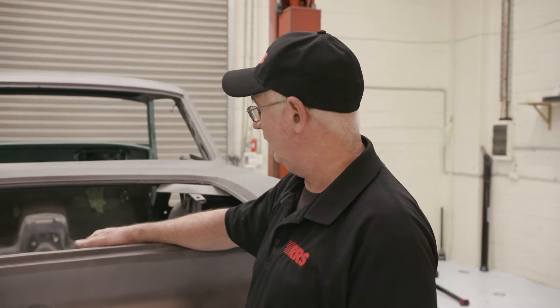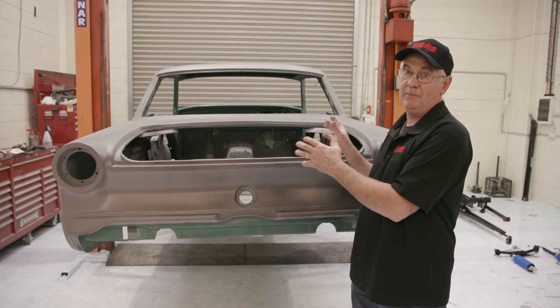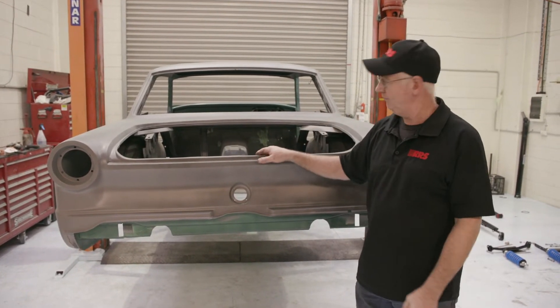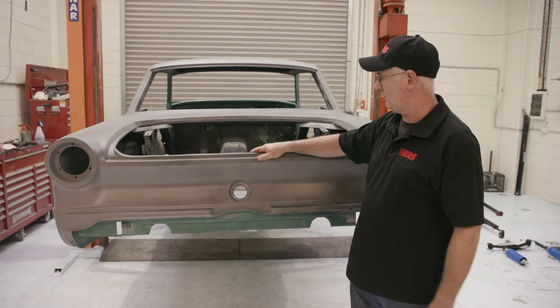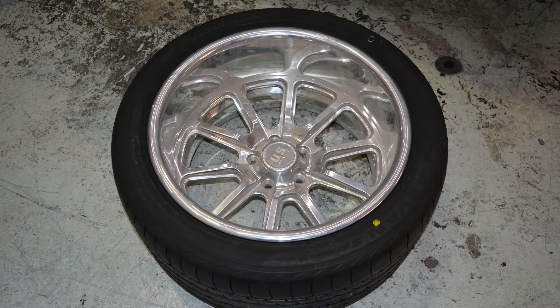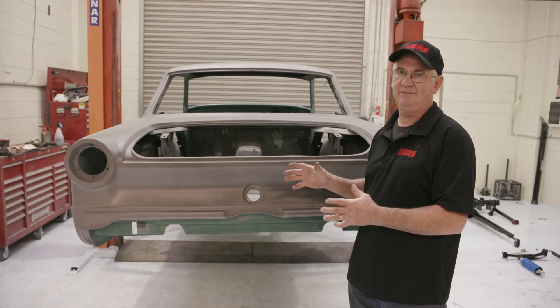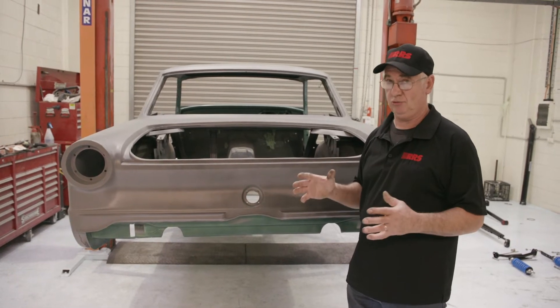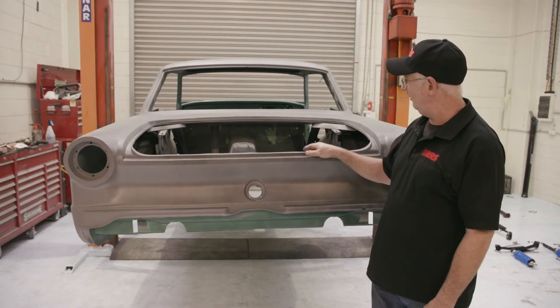He wanted a road-going car, a daily driver. So we'll take you through all of the changes that we made to show how this car has come along to this point. That meant that we had to pull all the back half of the car back out, put a donor back half in and put mini tubs in it, along with the floor and recreate the whole lot, almost back to original. But we've had to accommodate his massive big wheels. The correct wheels really should be purchased before you start building a car so that you know all the dimensions. So unfortunately we had to build a car around a set of wrong wheels, but we've accomplished that.